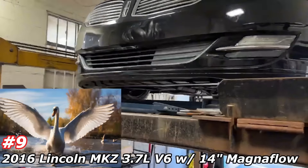Factory converter there, factory converter there, then goes into two flex pipes. It's true dual. Usually it comes single, but what we did is we cut it off, put a Magnaflow right there — dual in, dual out with a built-in X-pipe, and then another X-pipe behind it, so it gives it that double helix setup. Cuts down on rasp and gives it a really nice deep tone.